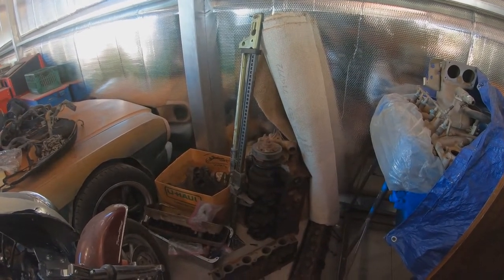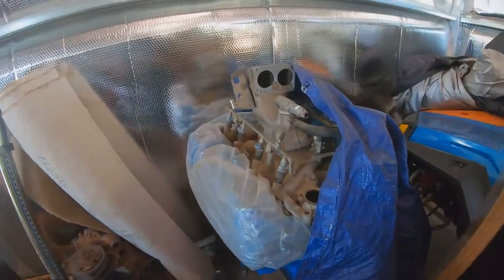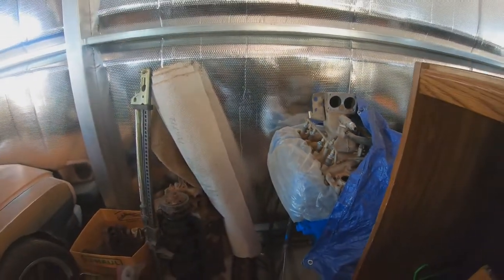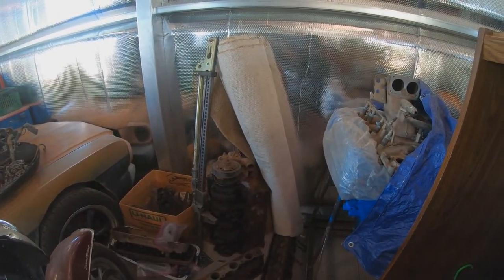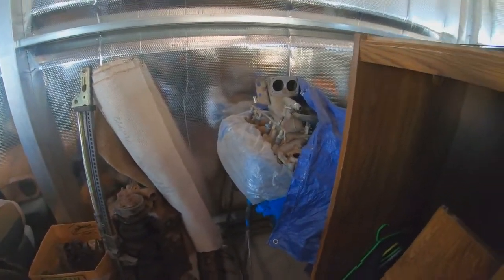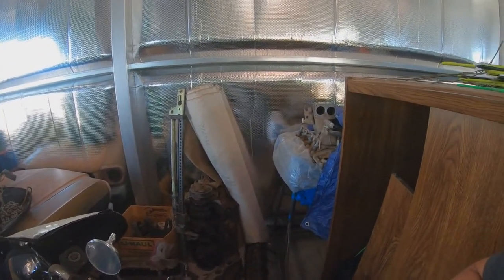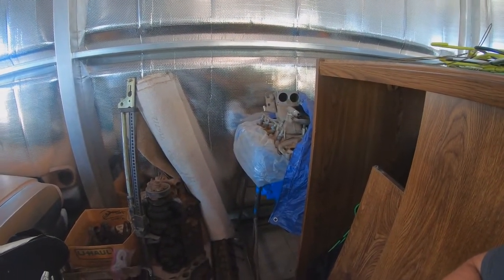And then once everything's set up, as soon as I blow the motor up, I'll go back and rebuild it. Probably use these 429 heads on this motor though, because they flow a lot better. And I'll use that intake. I think that intake's garbage. I might have to get a high-rise single plane and then make an adapter for it. We'll see what happens. I'll try to do that drag car on a budget, since I really just wanted to go fast. I know it's a heavy motor, but if I get the car light enough, it should hook pretty good with the right suspension setup on it. That's it for the motor. Oh, and the 429 is eventually going to go into another project that I haven't got yet. I'm going to do a 69 Mustang clone of a 429 Boss.